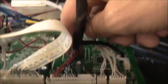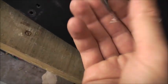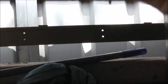This one, it's not a power supply issue. This BGA chip here on the AV board — the main board — this BGA chip gets hot after sitting for a bit. So the CPU, so to speak, has burnt out. This heat sink that was on it was only sitting on one of the corners. When they put this thing together at the factory, it wasn't sitting squarely on top of the chip — it wasn't making complete even contact on top of that BGA chip.